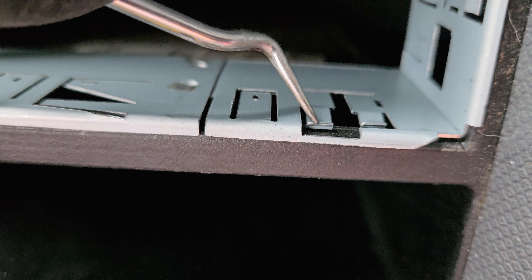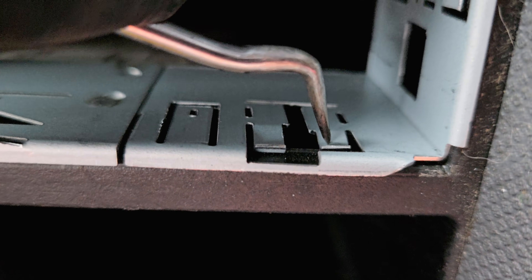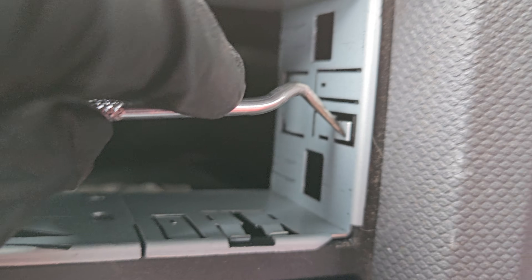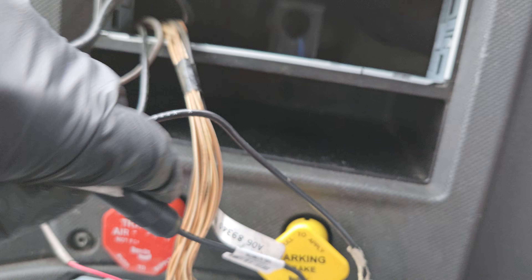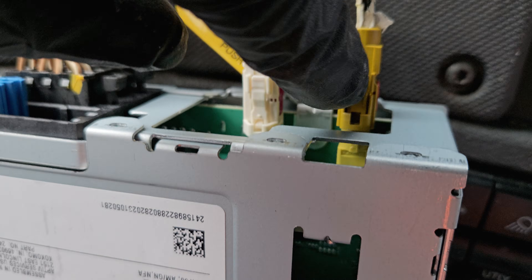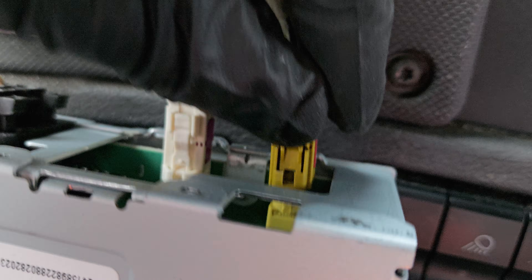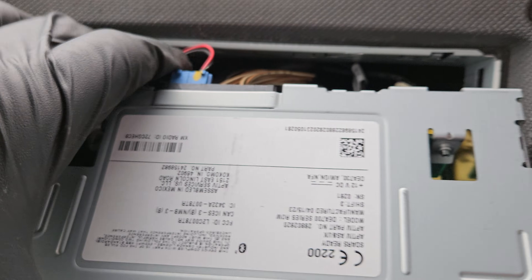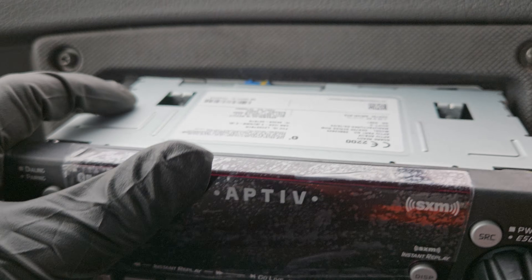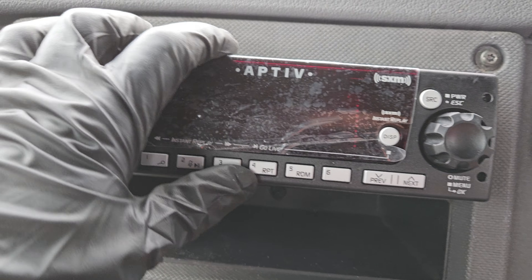You can see the lip is a bit in front, so push this one down so it goes behind the lip and can't come out. Do the same with the side tabs — you want everything nice and secure so it doesn't fall out while somebody's driving. All the plugs just plug into where they go. Make sure the antenna is good and secure. This connector — you can see there is a notch and a push tab. Go ahead and push those together, preferably with two hands. Get all the wires back as far as you can before pushing it in so you don't squish anything. Make sure to have it the right side up — I've put them in upside down before.